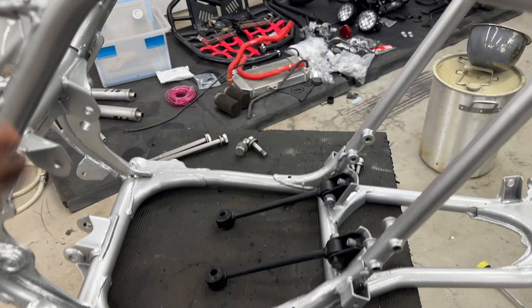Right now the only thing we did was officially place the bolt in - not going to tighten it down or anything. Sometimes I find the motor being a little bit loose helps the exhaust and things line up better. I know the CPI pipes were a brute to get in there, they were crazy tight, but I'm not really sure how these T6s are going to be. We went ahead and put the bolt in there, but you need to make sure that these little bumpers here go back in on the sides. There's one that goes on this side of the motor and on the opposite adjacent side up front.